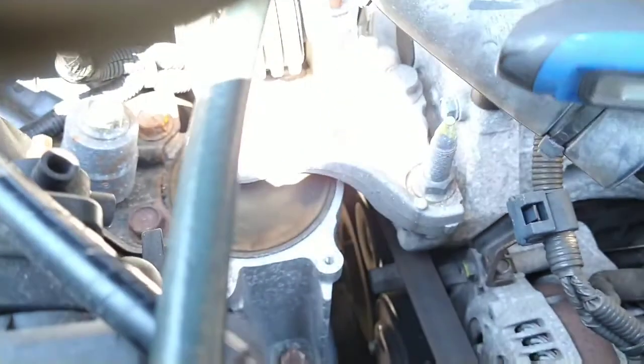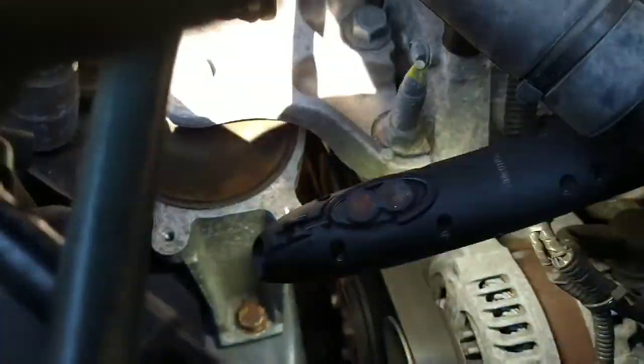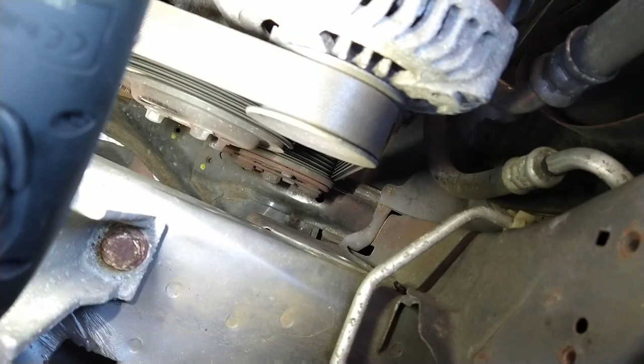I'll go back down to the compressor and just grab a light. This is the light I found under the bonnet the other day, so it's still going strong. I can zoom in on the compressor, on the clutch. If I activate the relay with my tester, you can see the gap closing slightly, but you don't get a click, and it doesn't close enough to grip the compressor pulley to run the aircon.